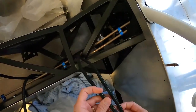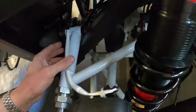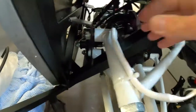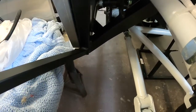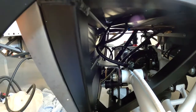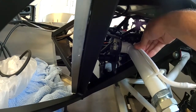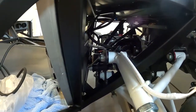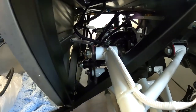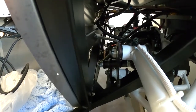Okay, so this is my right side. After thinking about this a little longer, instead of going up this way, back across and over, I'm going to run it down the control arm this way, pick it up onto here, and then I can shorten a whole bunch of wire. I'll have almost no motion on that wire at that point since it's right back at the pivot point, instead of out here where we'd get a little more movement.